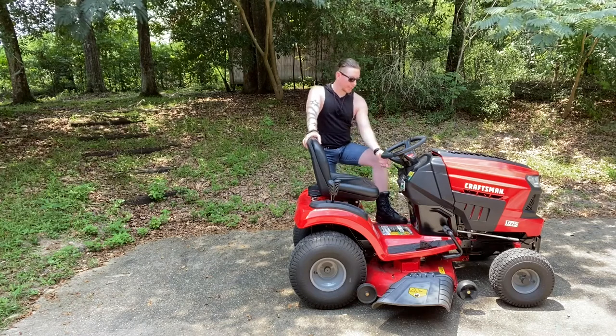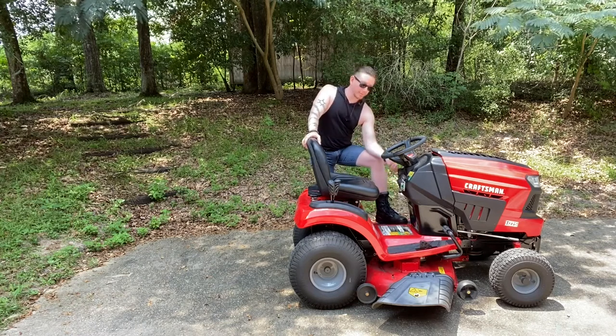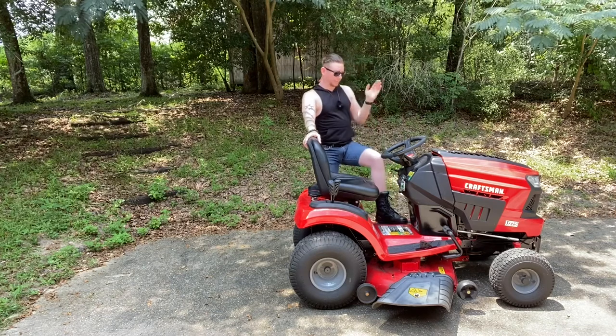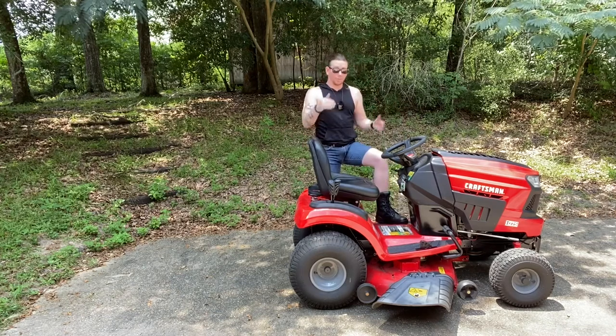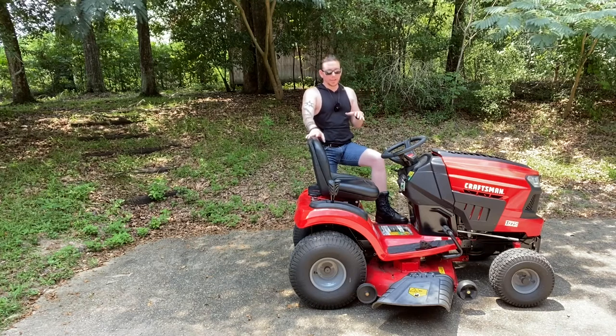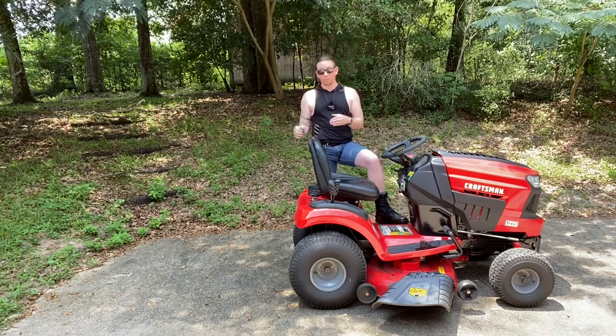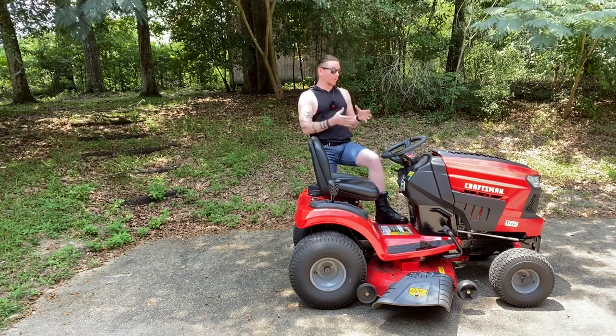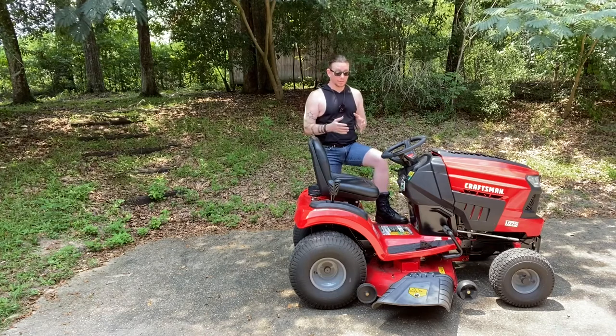This throttle is set up where the bottom is turtle, the top is rabbit, and the very top actuates the choke. It barely changes at all with the actuation of the throttle. So even though it'll mow, it doesn't get high enough revolutions where it can mow very efficiently. It still gets enough power to engage the PTO and will mow, but not as desired. So the performance is suffering,